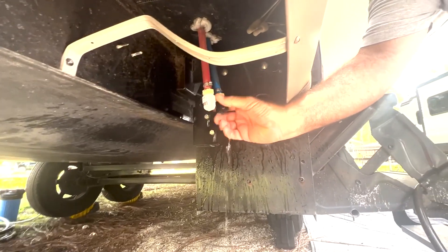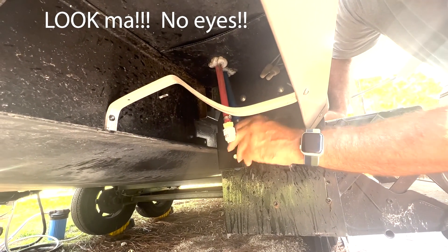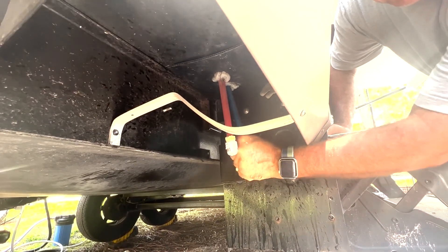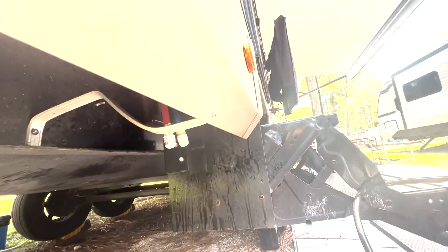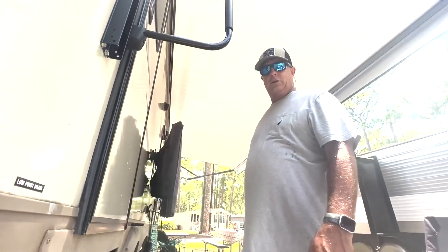I'll make this quick. Try not to strip it, because it's muy malo — it's no bueno. So I'm going to keep the one that was on the hot one, just in case. You don't really have to crank on it too much because of the plastic pieces in there. I'm going to go ahead and turn it back on — let me know if it starts squirting. Any drips? No. Good to go? Not a one. GTG. There you go — that's easy. So you use that, when you drain it all, to put in the antifreeze if you're going to store this in the winter.